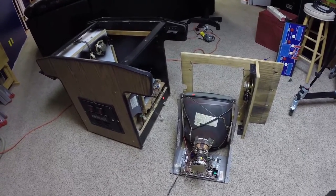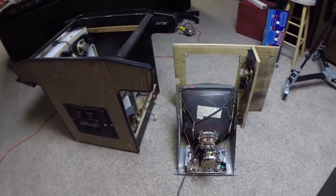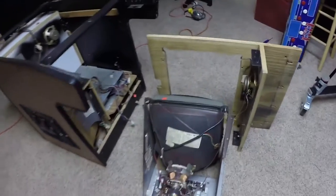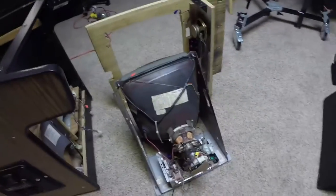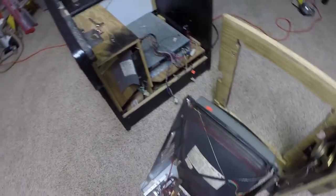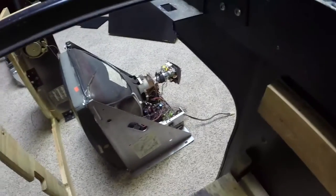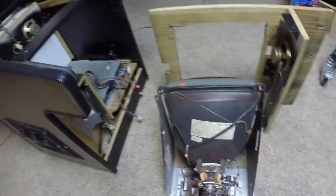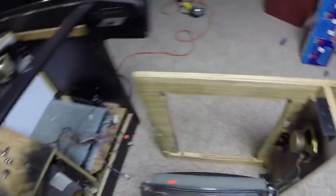We're on to the next phase of the restoration and repair of the Track and Field Cocktail. Right now I'm going to attach the Wells Gardner 4900 monitor to the Track and Field Cocktail monitor front wood frame — kind of tricky. There are a couple of parts you have to take apart to get this drawer out. You actually have to unbolt some spots inside the cocktail. There are brackets on each side that you have to undo, and you actually have to take off the control panel, take the glass off of course. So right now we're going to bolt this monitor to the wood frame and slide the frame into place.